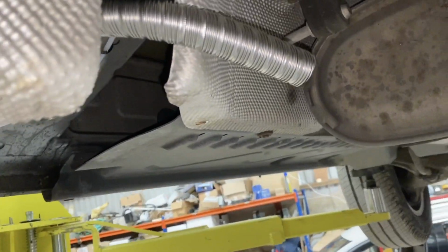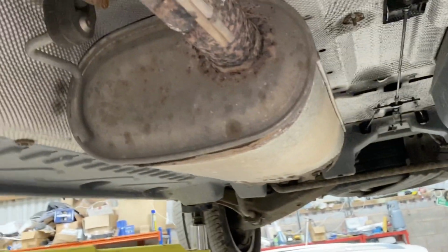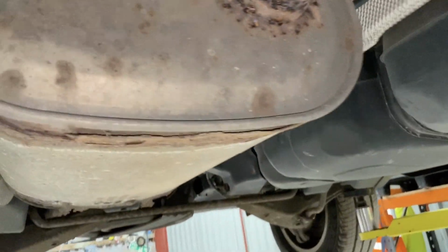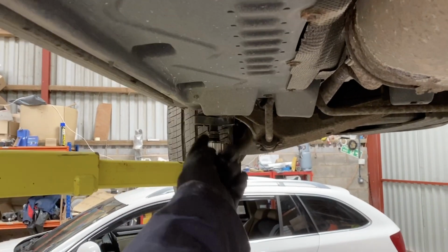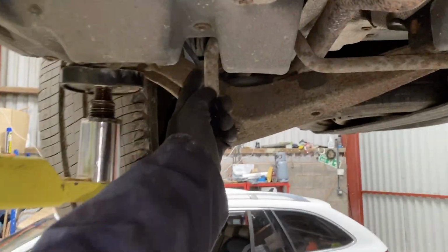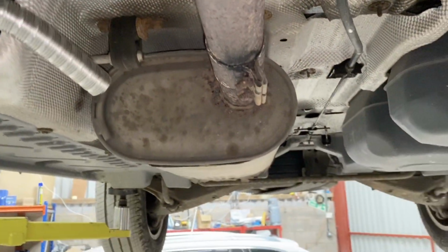I don't particularly worry too much about fumes going up inside the van from here, because there just aren't any holes up there. What we have seen, sometimes people put the exhaust very close down this end somewhere here and put a hole out, but that can be right underneath a gas dropout, because often the gas bottle is immediately above here or further down the back. So we have seen gases going from the exhaust inside there, but I find if you bring it out into the tunnel, the wind will just disperse it.